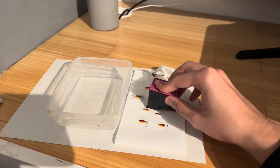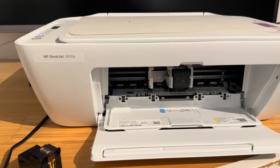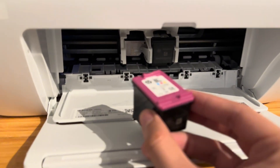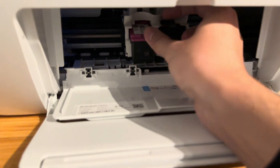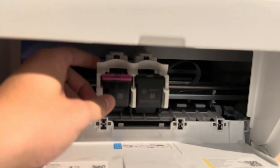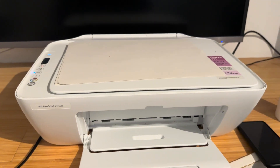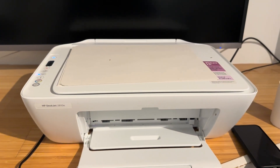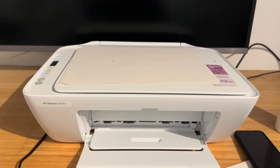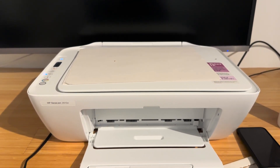Now that it's fully dried off I'll make sure it's dry properly before putting it back in. I've got my dry ink cartridge and I should be able to put this straight back in. Remember to be a little bit careful — I like to put my finger up here for some leverage. Clip it back in and shut that. So those are my recommended solutions to solving any issues you might come across with your HP DeskJet printer printing blank pages.